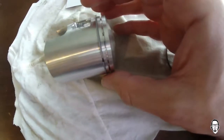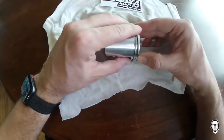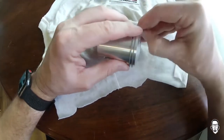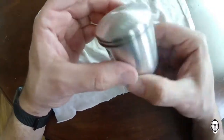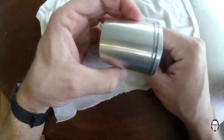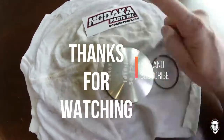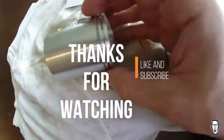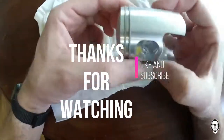So I'm just gonna line up my ring right down in the groove. I put it down here, just kind of push it over, and when I get to the end I kind of lift up on the ring — snap — bang, there you go. Now I'm ready to get my piston and my cylinder head. I'll flip it over.